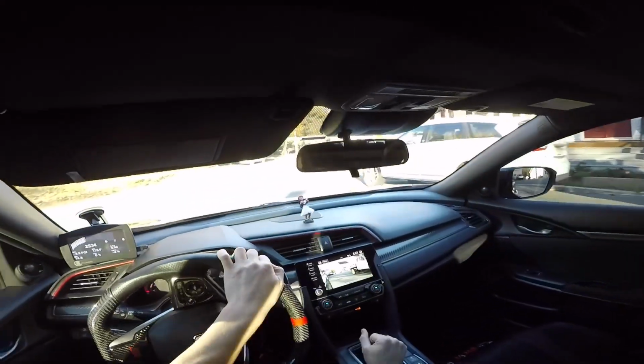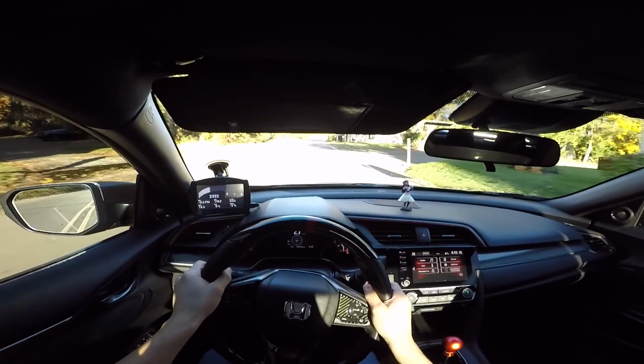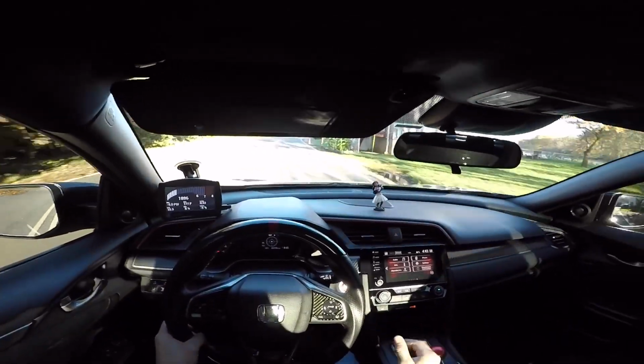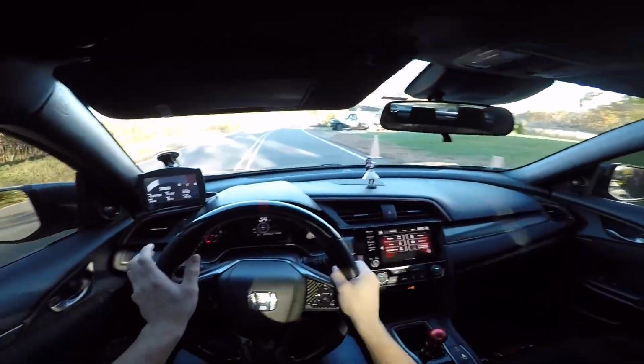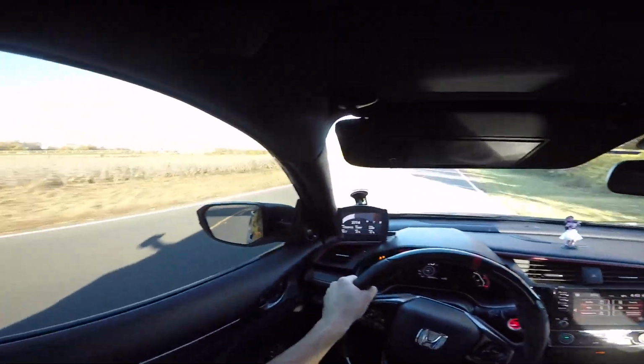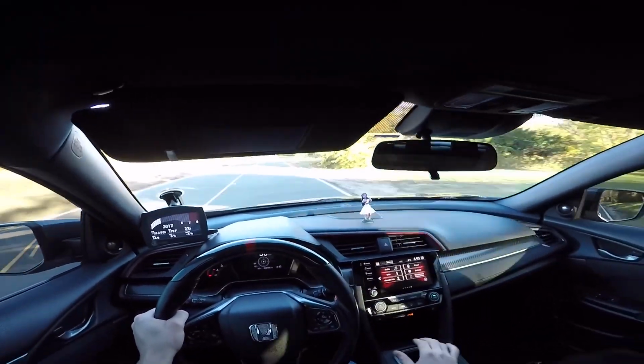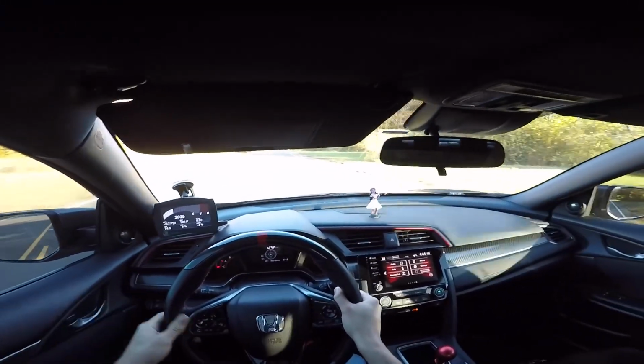because you're talking about a bigger turbo and an upgraded fuel system. You're going to need a built block. You will need a built trans at that point. It gets really, really expensive. A lot of other Honda platforms are known to be super reliable and handle that type of power, but the 1.5 is not going to get you there.